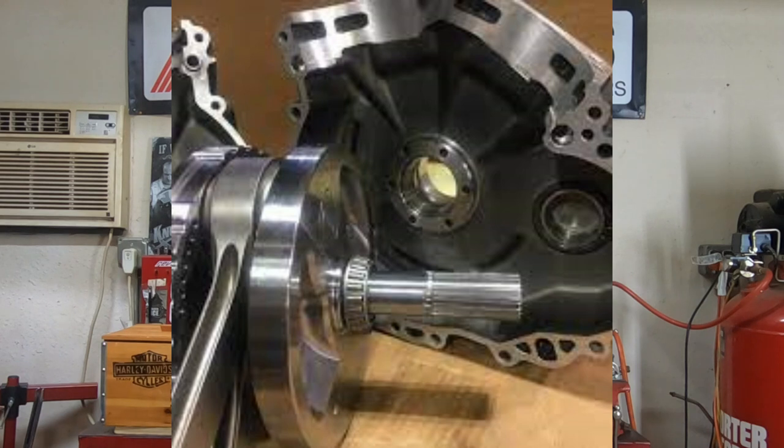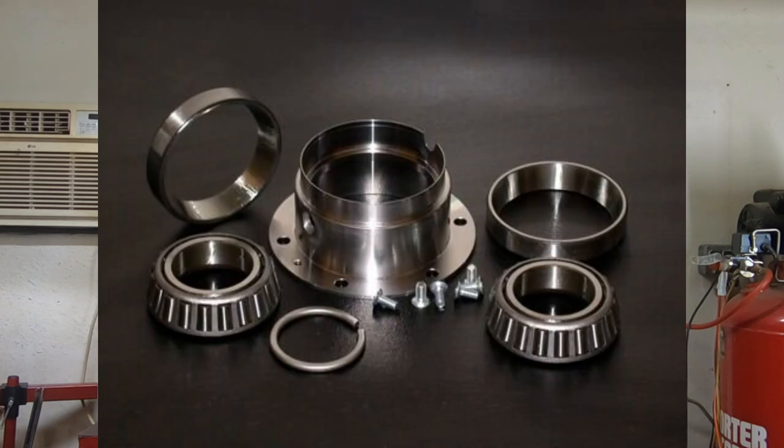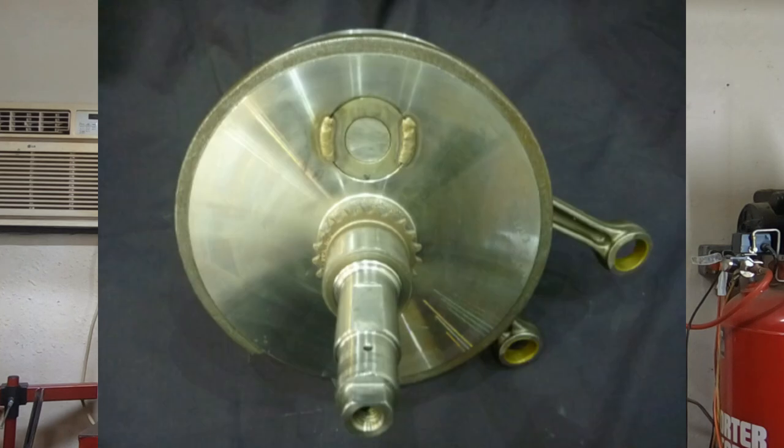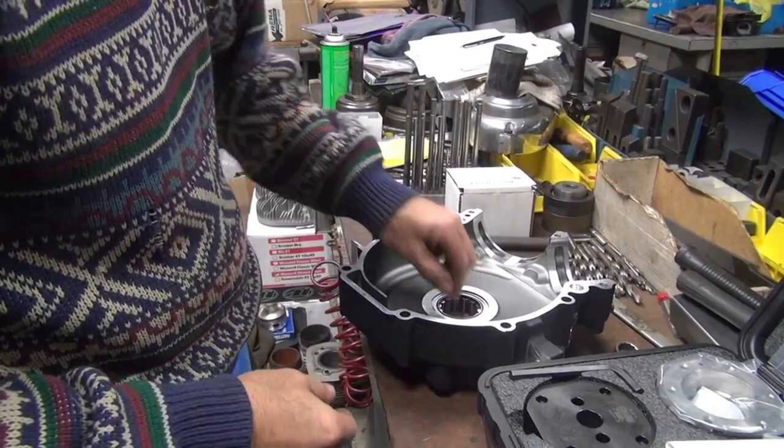Same thing with a 96 or a 103, but the main goal with getting down that far on your twin cam engine is if you have a 2003 or newer, you're definitely going to convert that back over to the Timken bearing with the sleeve. The other idea when you have those cases split is to go out and buy a good built crank — something from Dark Horse or S&S, where they've actually gone through it, welded the crank pin, it's got really good connecting rods in it. That, matched with the Timken bearing setup and set up properly, is going to be very important. If it's set up properly, you're never really going to have to worry about it again.